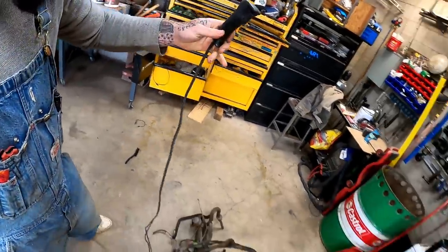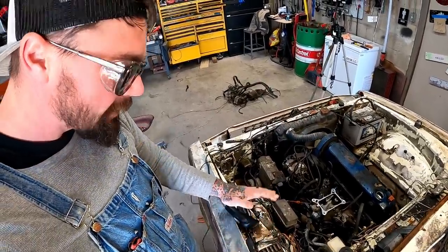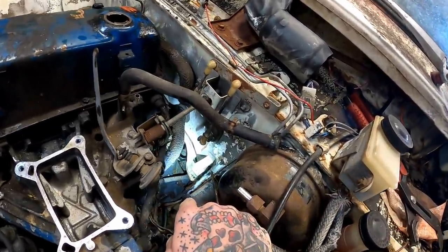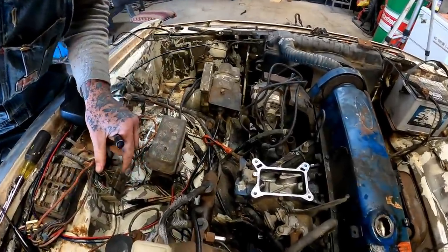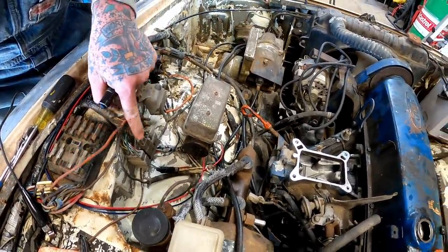Let's get her squeeze trigger on here. Take this side straight to the battery. Of course, this side goes on her starter solenoid. Little problem on these. That starter's just way down there in Alabama and I don't feel like crawling down there. Now, easy solution is, there's a quick connect right here for the harness. And well, that big black wire right there with the yellow stripe. I do believe that's her.